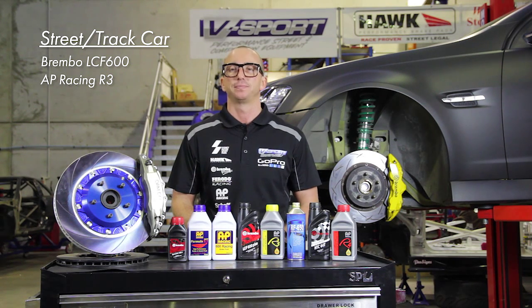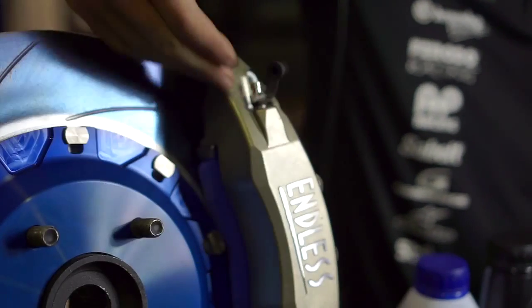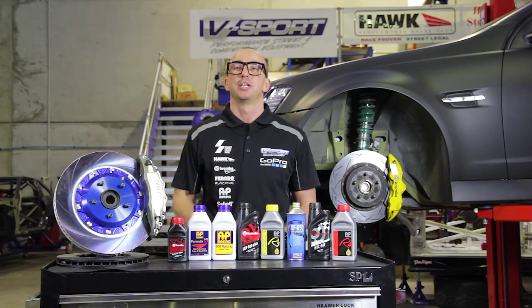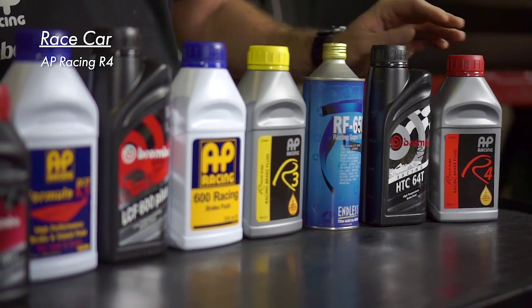Both were most recently tested extensively in the Twilight Rally Sprint Series. Around this point we recommend bleeding your brakes at each event — simply cracking the bleed valve, resetting the pistons, and bleeding the old fluid from your calipers will see consistent performance from your brakes lap in, lap out.